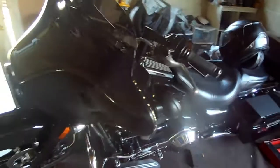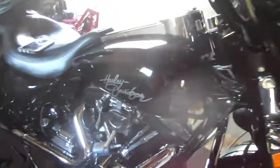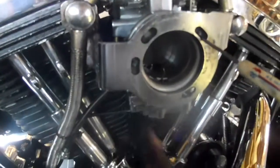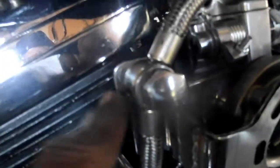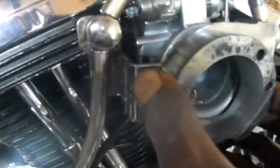Okay guys, welcome back to the channel — appreciate y'all dialing in. This is OG Trip. I've been having some problems today with my bracket right here for my carburetor. The problem I was having is that I really couldn't get enough threads down into the head right here to keep that secure without the vibration knocking these plates off.